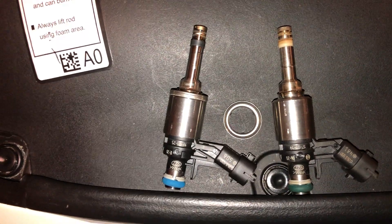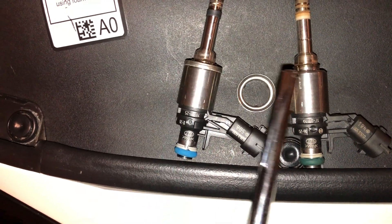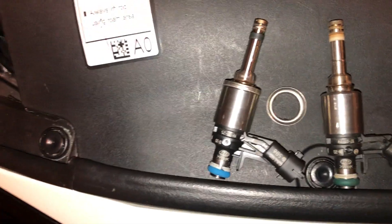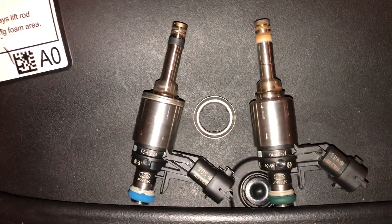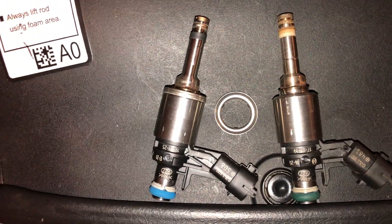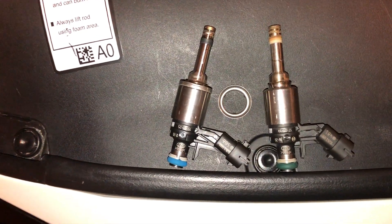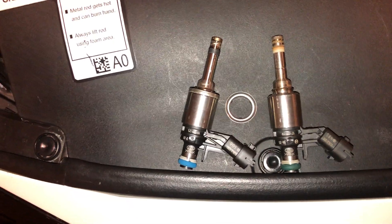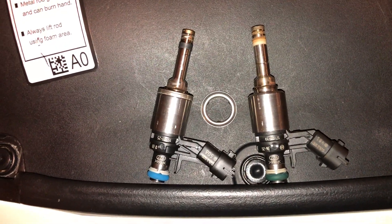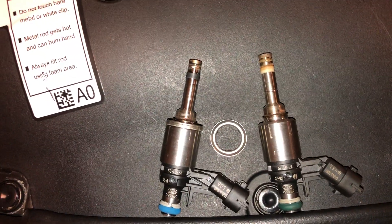It's a small modification that only takes a few seconds. I already did the swap of the rings — there's a little spacer ring, a thicker ring. On this injector I just took a flat-tip screwdriver and popped it right off. The Civic Type R requires a scribe — it has a little locking clip that holds the spacer on, so you take that off and it just transfers right over. I took all the measurements and they're the same — it's identical other than the pitch of the plug.